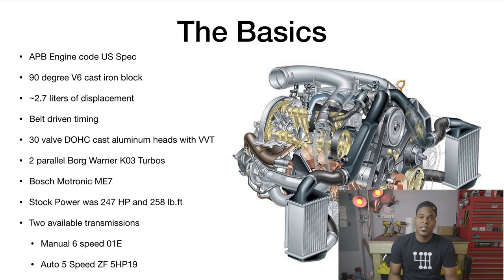These cars were meant to be driven quickly around town and corners — that's where they do their best, and it's also why they're not great in the quarter mile. Those first two gears are just geared toward making this engine feel torquey. The ECU is a Bosch Motronic ME7, which gives us the ability to tune these cars as far as we do. Stock power is 247 horsepower and 258 pound-feet of torque, with that torque coming in really low.